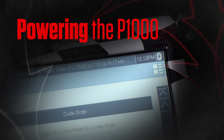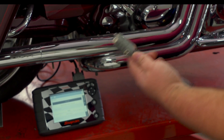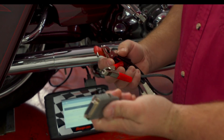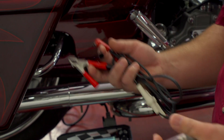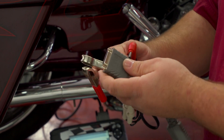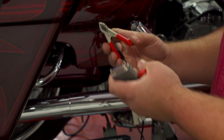I see the charging icon — where's the power coming from? This tool, when it's plugged into most bikes, it'll get power from the bike's battery. What if it doesn't get power from the battery? We've got you covered there. What I've got here is a Suzuki adapter, and this is one that would require external battery power. We include this with all of our kits, and you simply plug in the barrel connector right there, and then these two connect onto the bike's battery.